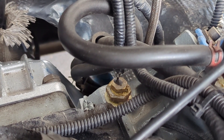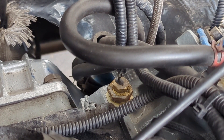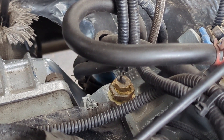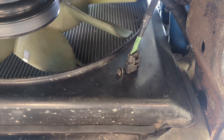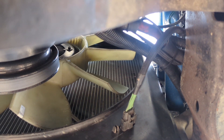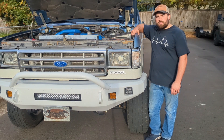This is the coolant temp port in the back of the driver's head that I use to control my fan clutch controller. I've found it to be within two degrees of the engine block over-temp sensor location, which is where my aftermarket coolant temp sensor is. As you can see, it's pretty easy to get to and provides good wire routing. On the passenger lower side of the radiator shroud, that's where I suggest having the 6.4 male side of the connector come through — cut your hole there, and my supplied female connector connects right to it and travels up into the wire loom to the controller.